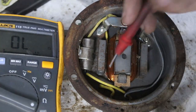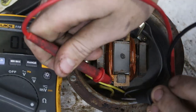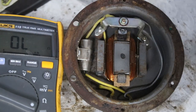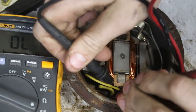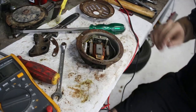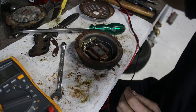This wire here, checking it down to the coil — that might be our problem. The power to the bottom side of the magnet is reading not connected. Further investigation is required. I think I'm just going to take the little spring connection part out so I can get a better look at where all the wires go.